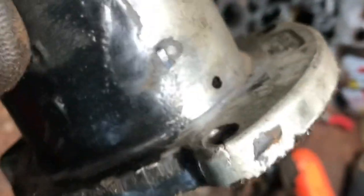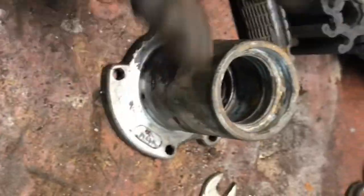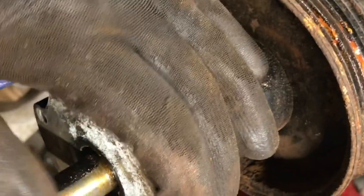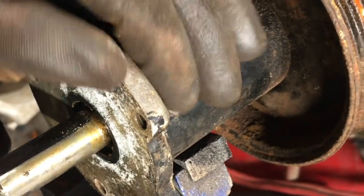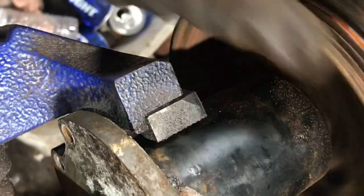I also did a little reading that these drain holes are weep holes — so when the pump seals start to fail, it leaks seawater in and fills your bilge up with seawater. That's not good — they can both sink that way. A little tiny pinhole would take a while, but still. One salvageable seawater pump — time to rebuild. More parts. Probably adds another couple of days to rebuild. I have 104 days left before I can put the boat on the mooring. I think I can make it with all these parts — I don't know.